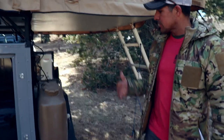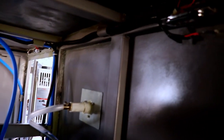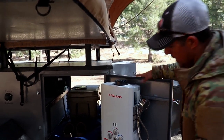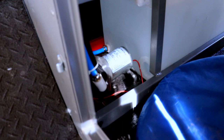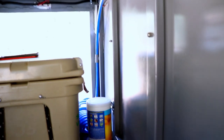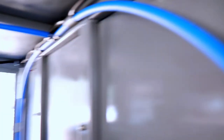Moving along to the passenger side, I've got some spare gas. My water intake is right here — I basically connect the water hose into this and it fills up my water tank inside. On this side, I have a propane tankless water heater. I have the hose in the tongue box connected here with a propane tank and basically have instant hot water. Inside, there's the water pump — once I turn the switch on that little box, it pressurizes the system. It's plumbed through the roof and breaks off in a T: one side goes to the water tank, and on the driver side it goes to a water hose. Eventually I'm going to build a sink on that side. All the electrical runs across the top with the interior lights.